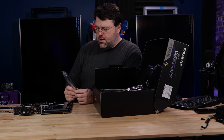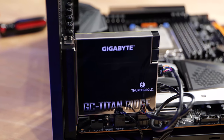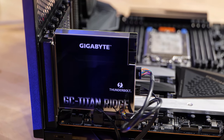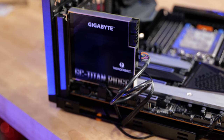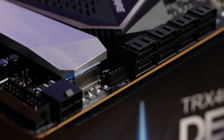Why are the mini DP to DP cables in the box? You can go from your video card out, into your Titan Ridge add-in controller, and then you will have full DisplayPort on your PCIe over USB-C with DisplayPort connections — your Thunderbolt-like interface.